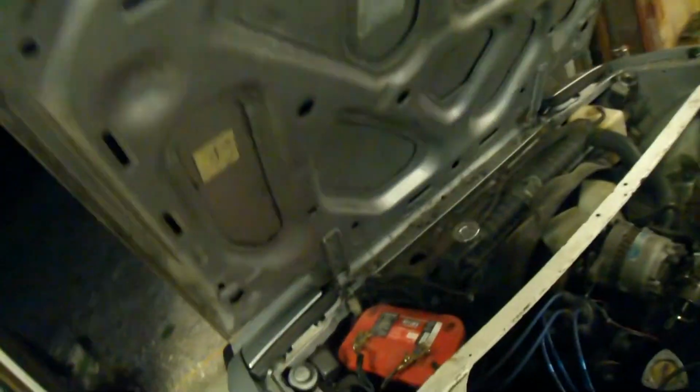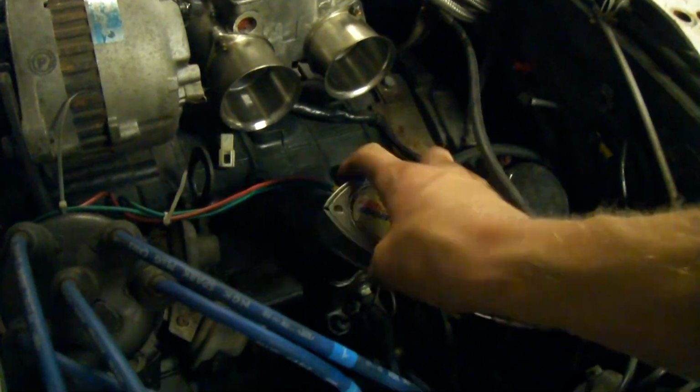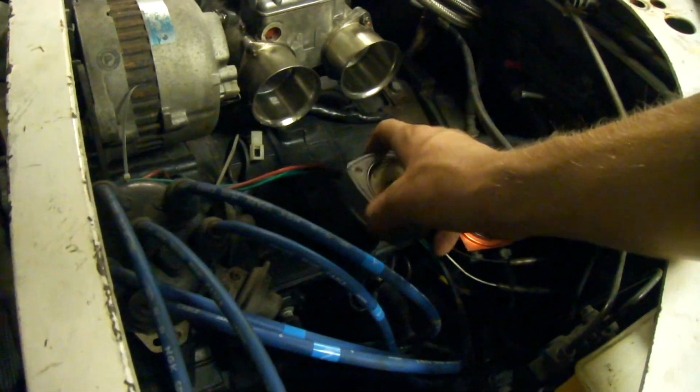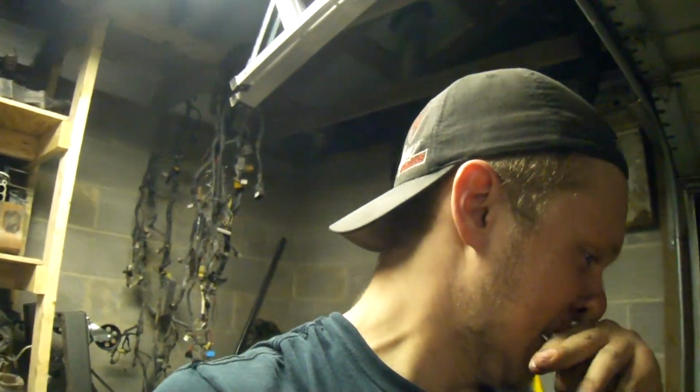The other thing, and maybe comment below if you've ever experienced this, but I have this super cool vintage Racing Beat oil cap. You can see it right there. It's pretty trick, but watch this. It's not coming off. There's a set screw on the bottom of this somewhere that's supposed to lock this, and I need to pop the filler tube off the motor and see if I can get the set screw from the bottom and tighten it back down. I guess this rowdy bridge just rattled it loose, but we gotta fix that.